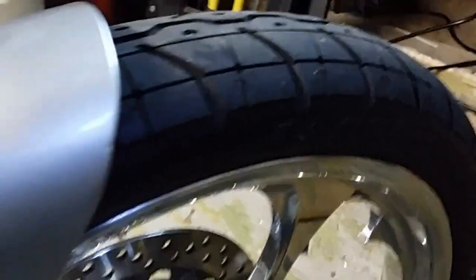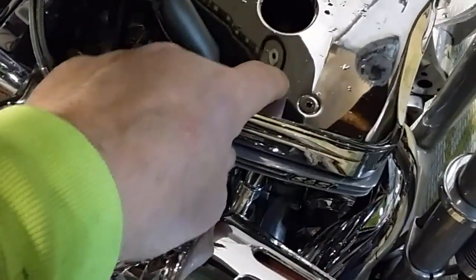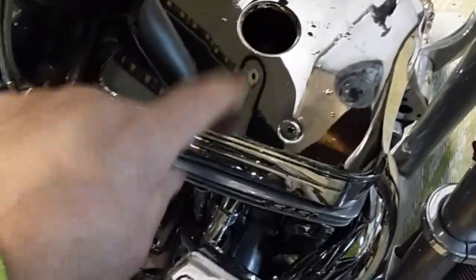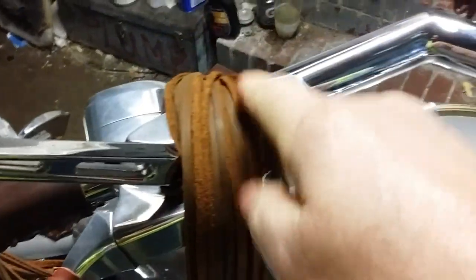When I got this there were a lot of scratches on these wheels. The tires are still new and still good. These are cast aluminum — that's why the chrome will flake on them. Same with these over here — also cast aluminum, and you can see the chrome flaking on it. The chrome will flake on cast aluminum. The speedometer housing is aluminum, the hand grips are all aluminum — all this aluminum has to be taken care of, because the aluminum will fade big time if you're not on top of it.